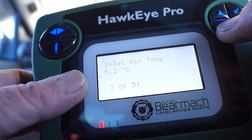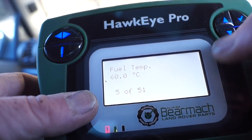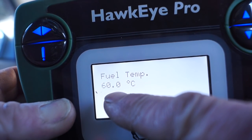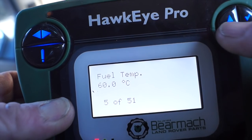This is a little bit of an educational course — just follow along. The fuel temperature is reading 60 degrees centigrade. Because this is a default setting the ECM has put in, it means the vehicle will still run with the sensor disconnected.